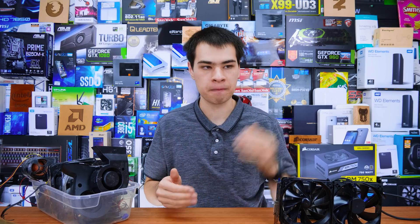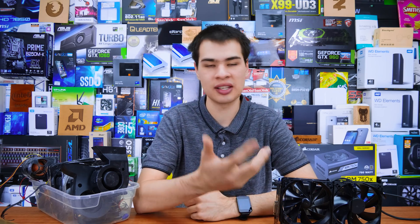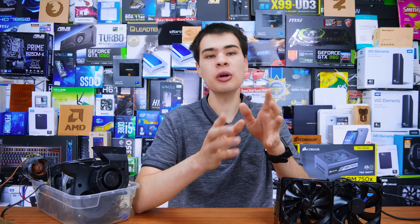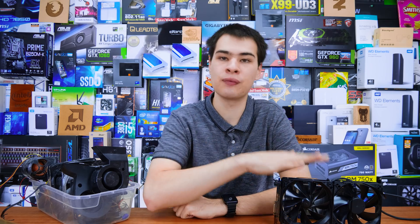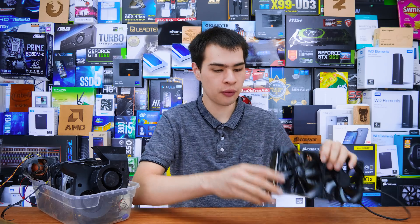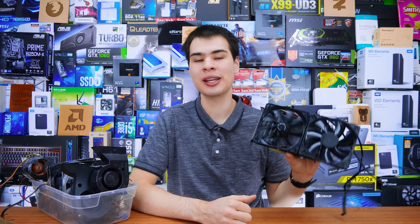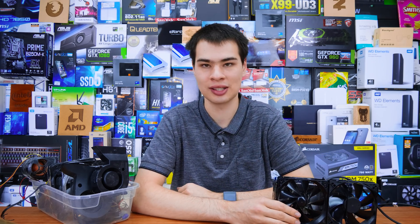I believe they just got the computer, put it under their desk with a nice big mesh intake and vacuumed the intake once every year or so. So this video card literally got no service, which made the fans basically die and seize up. Sure, if you manually move them with your finger, the fans kind of moved around with a lot of force required, but all in all the card finally gave up. The actual core itself, the outputs, the whole internals of the card work perfectly fine — it's just the cooler assembly that is no longer working. And that is where we're going to be doing some DIY stuff today.